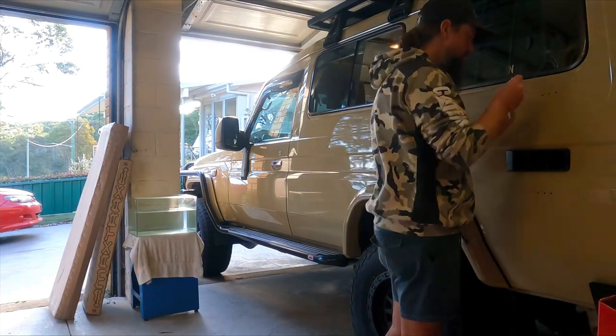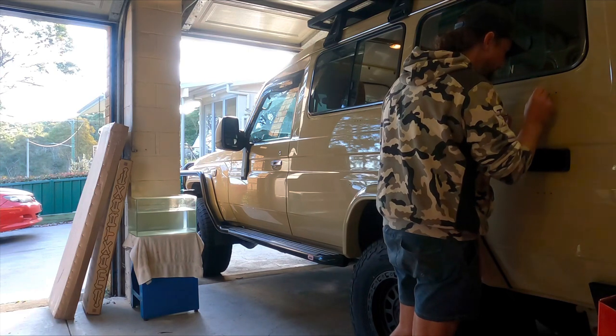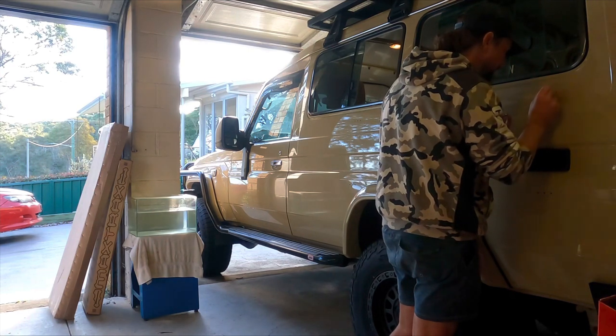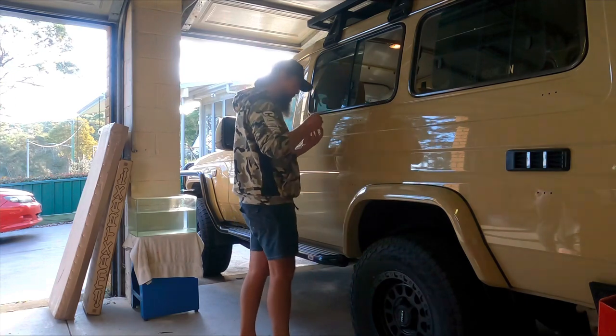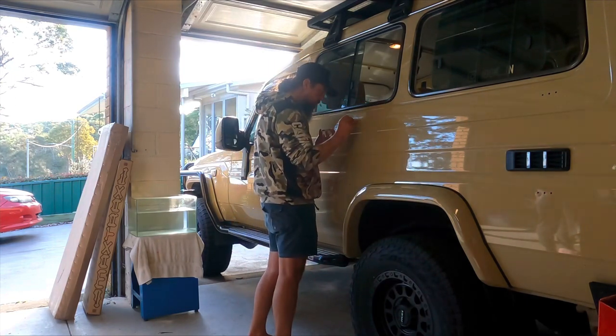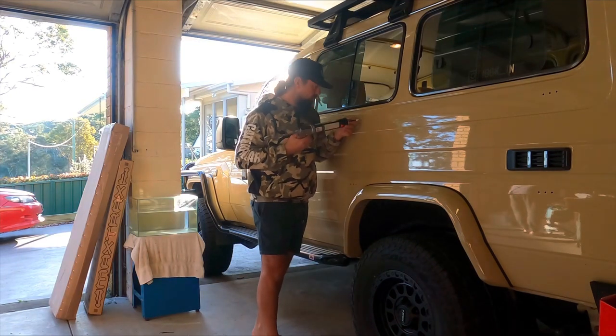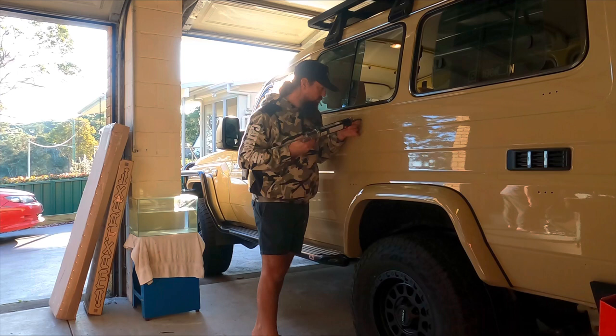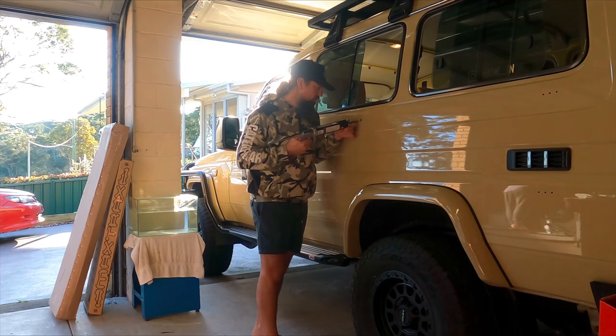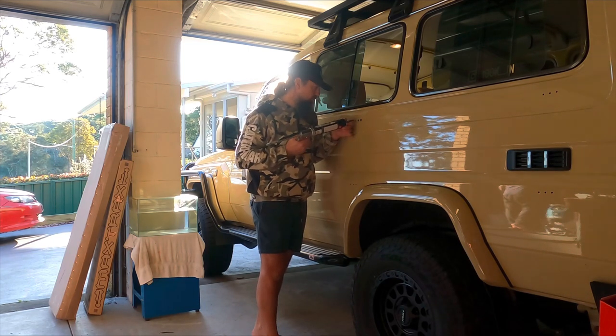You want to make sure that's sealed, basically. You don't want it rusting from the inside out, so just make sure you get a nice coating of that cold gal on there and it should be happy days. Once you've got a good coating and it's set and dried, you're pretty well ready to put some of that automotive grade Sikaflex around those holes.